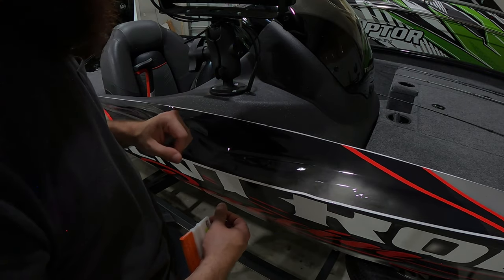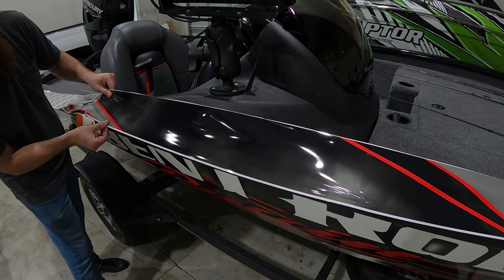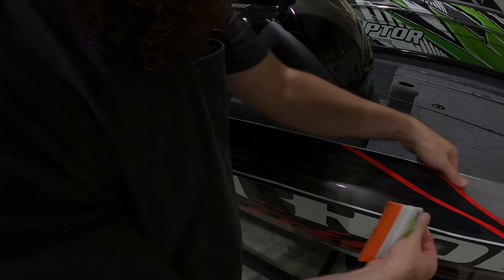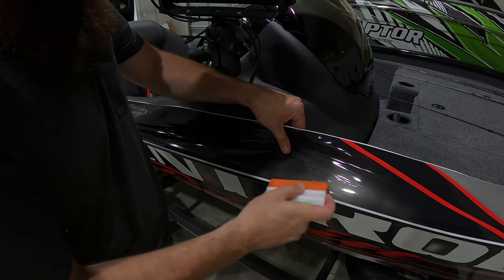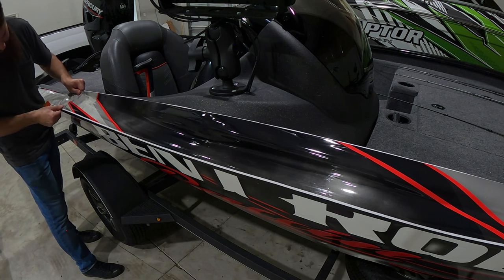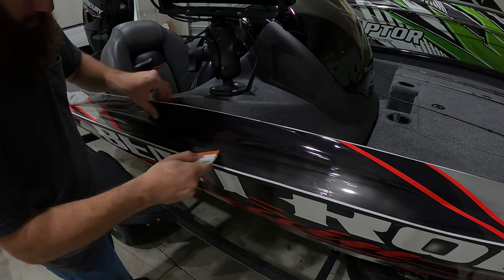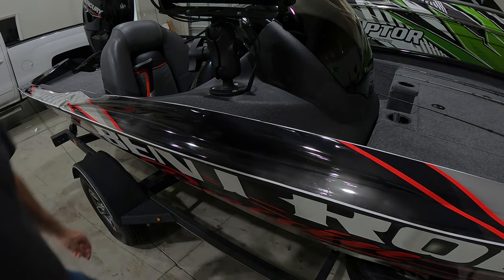You could remove your console but it's kind of a pain, so I probably wouldn't. We're just going to get that chucked down in there — it'll just be hiding under there. Just kind of get that edge kind of locked in place — make sure you don't go off course, it's easy to do because it is a little bit of a curve. Put a little tension on it — that'll help fit that glass. I'm just kind of giving it a little tug towards the direction I want the wrap to go. Just using the tip of the felt side, still going at those 45s.